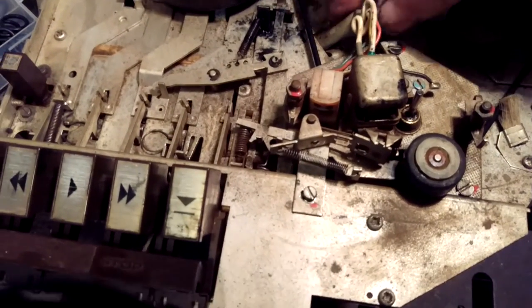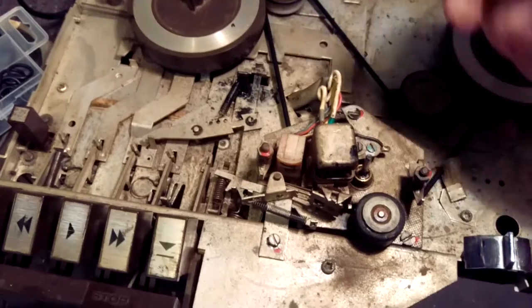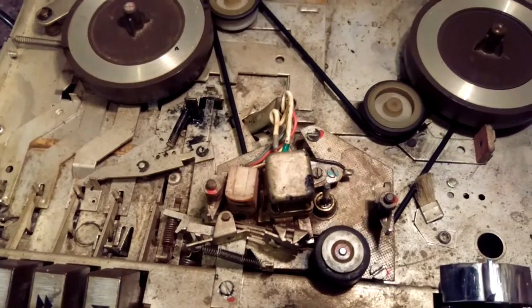And if you haven't got enough cable, just relieve it — there's a cable tie at the back of there, just release the pressure on that to allow you a bit more slack. Lift it off, put the belt on — it's pretty obvious — round the capstan flywheel.